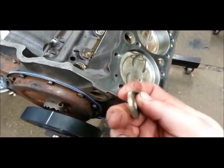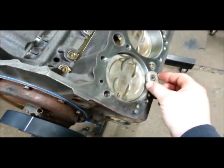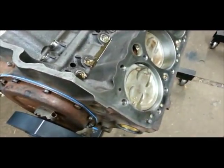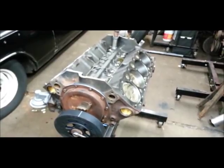I just took a washer, crimped it over a little bit, and you just bolt it on here and it'll stop the piston. I'll show you what the significance is of stopping the piston. But I'll put the head on so we can simulate what you've got there, Rick. Just hang on.